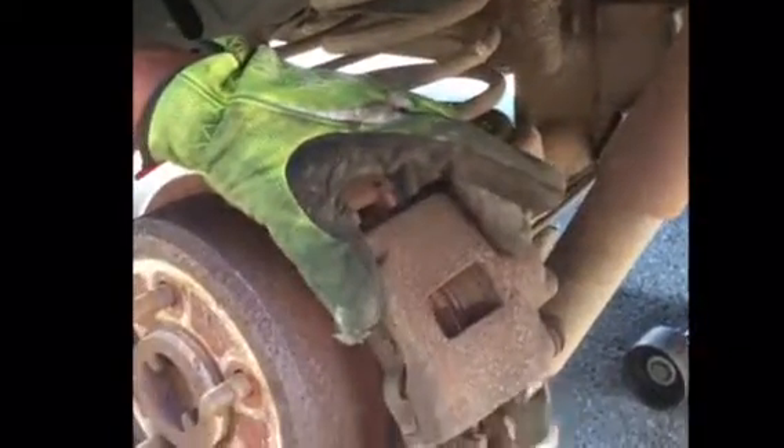Since this is so rusted on and caked up, I'm going to have to bang this caliper loose because it's not coming without a fight. Get a three-pound sledge or your weapon of choice and just go to town. After banging for about 20 seconds, it's finally starting to come loose. You just want to shock it, because when vehicles sit, sometimes the caliper can actually freeze itself to the brake pad, making removal difficult.